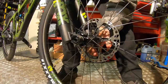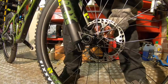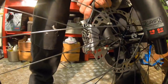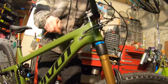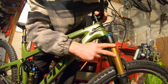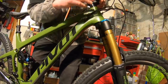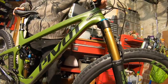Getting this front wheel in — QR15 axle, as you'd expect, standard boost on the front. Nice big front brake rotor. As you can see, it's the four-pot XTR trail brakes, so decent stopping power. Coming up the leg — Kashima, as you'd hope on a £9,000 bike — you are getting a top-of-the-range factory fork. 160mm travel, short offset, so light bar feel but super stable in terms of front-end feel.